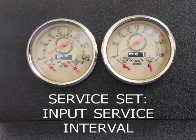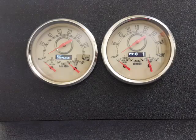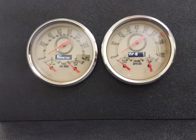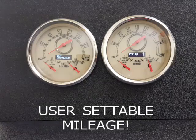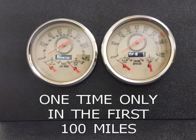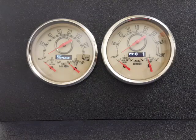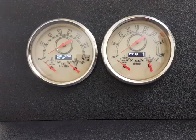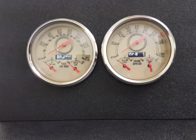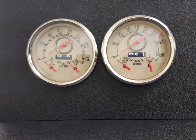Service set allows you to set the mileage for your service interval — very easy to set up. Set odometer is a new feature where you can set the mileage to match your vehicle. Here in Michigan we're not allowed to do that ourselves, but we were able to add this feature so it can be done on-site within the first 100 miles of use. Auxiliary input: each speedometer has one auxiliary input, so with three inputs plus the six gauges, you can actually have a nine-gauge kit displayed, plus additional custom options are available.